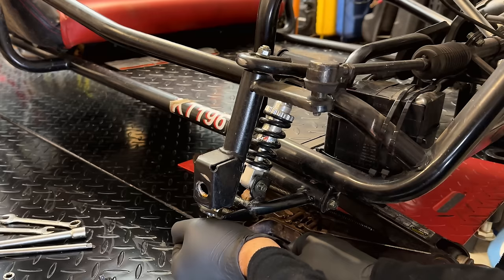That's a nice looking engine. Unfortunately, it's not going to work, at least not without some modification. Now, my mistake here was not pulling this engine first and measuring up this crankshaft. Instead, I did a little bit of research and found the specs for this engine. And according to that, it said it had a 3/4 inch diameter shaft, which it does, but the length was supposed to be 2 7/16 of an inch. And this is actually 2 3/4. So this is quite a bit longer than I thought.